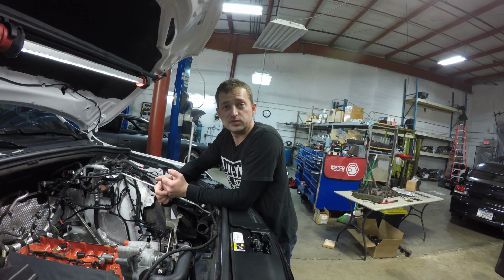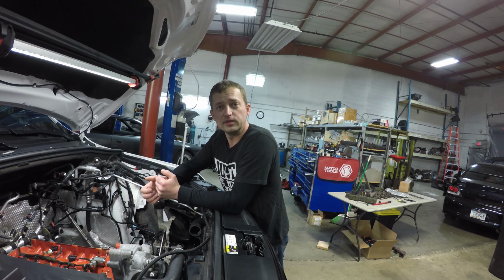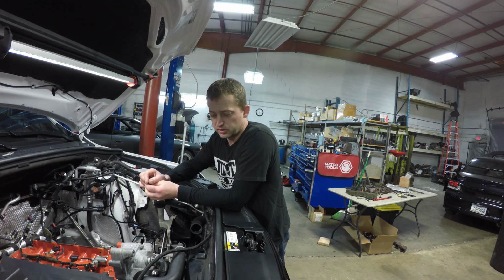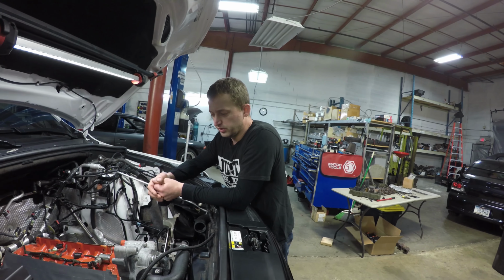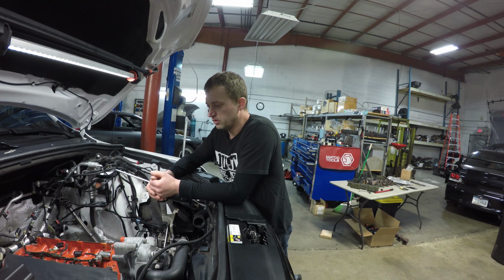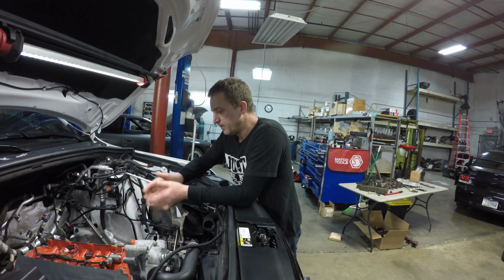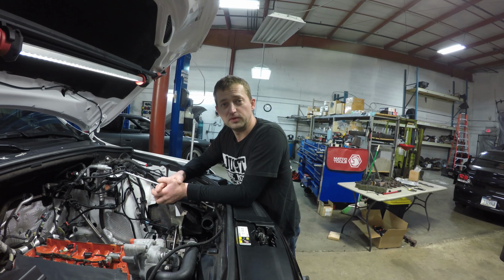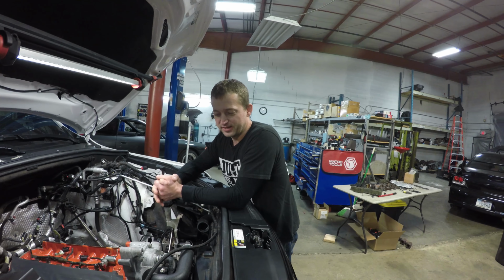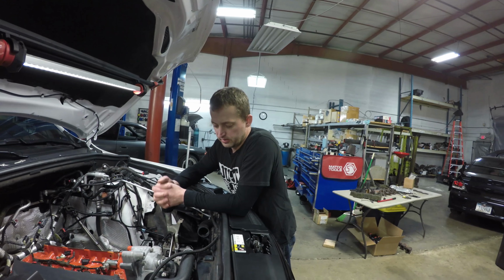Yeah, agreed. Especially when the 6.1s were breaking springs. Oh, they were? I didn't know that. I had quite a few trucks brought in with broken valve springs, and then you take the motor out. So I believe the 6.4s, the Apache heads, redesigned it, better springs, etc. Nice. But it's only money. It's not a ton of money, so we'll put a set of Manleys in it. Yeah, and that will keep it.